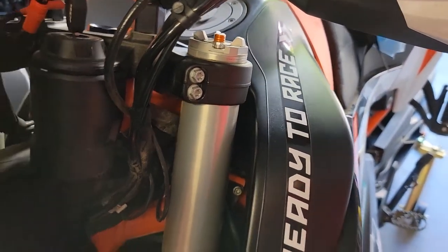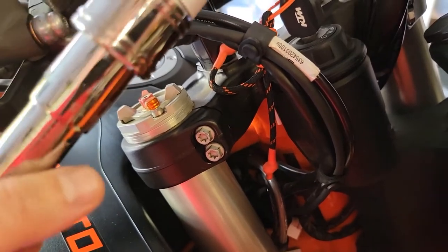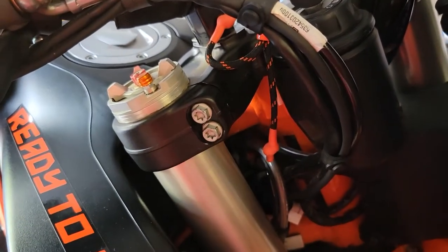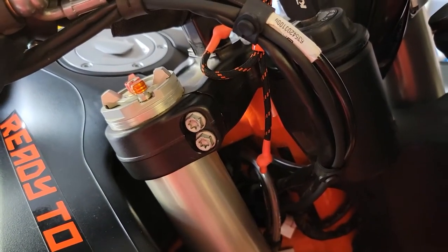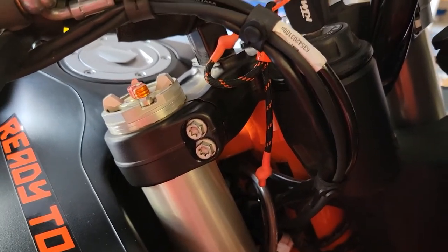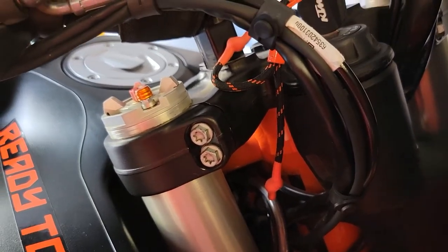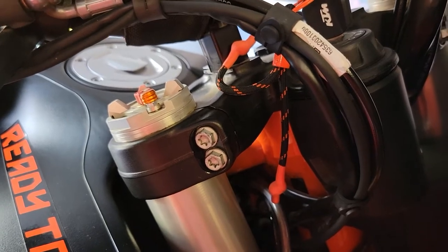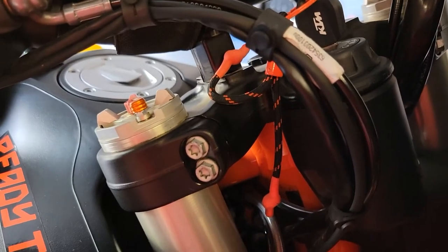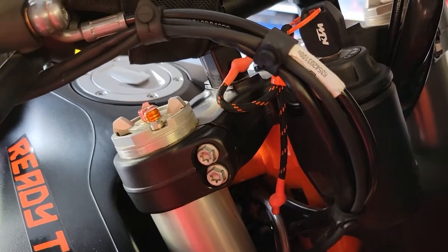I did the same on the other side, moving back and forth with the torque wrench. I snugged them by hand first with a regular ratchet to see how close I could get — but the torque wrench got about another eighth of a turn more than I would have gone. So it's good to use a torque wrench on those.